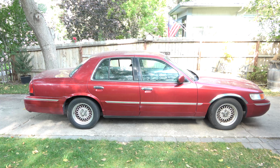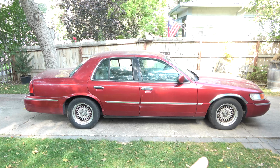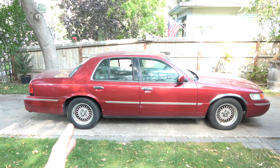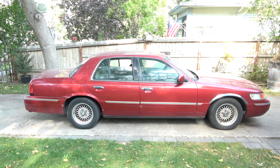We'll get stuff done. So what we're going to do first is we're going to raise the back of the car up and we'll block the wheels. The rear of the car will get jacked up. We'll put it on jack stands. And then we're going to let the front suspension droop, and then hopefully we can trick the air suspension computer into airing down the airbags. That'll be our first thing, is getting the airbags out and putting in our new ones.